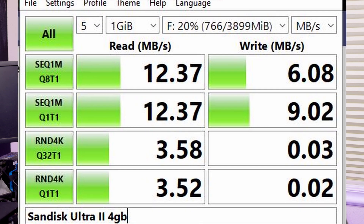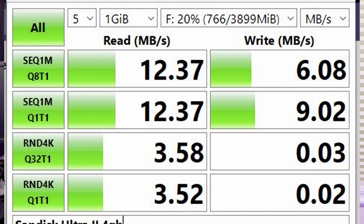So not very fast, especially compared to modern storage. I compared it to an older 4GB flash-based CF card from a similar era, and it was about 12 megabytes per second read and 6 megabytes per second write. So the flash-based card was getting about double the speed, but also at over double the cost, making the micro drive a reasonable compromise for a lot of different use cases.